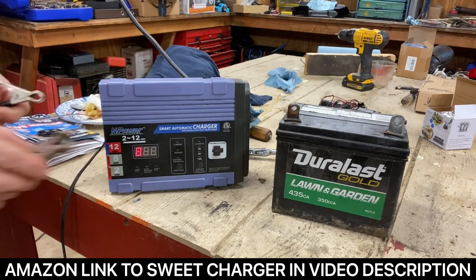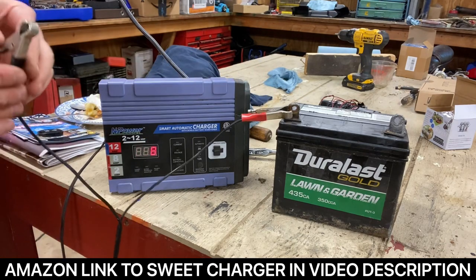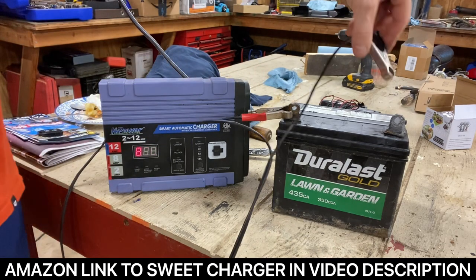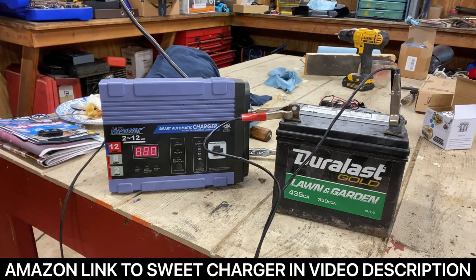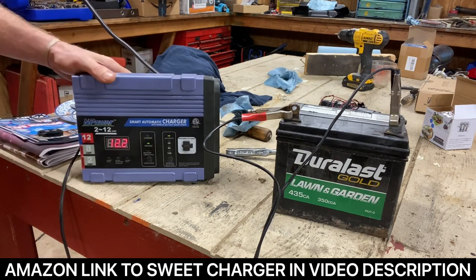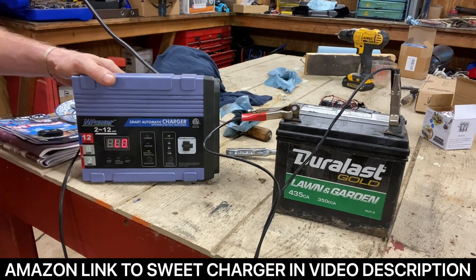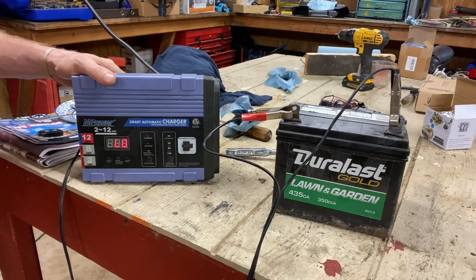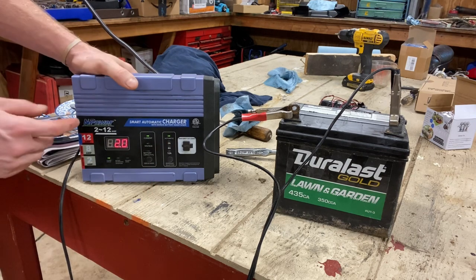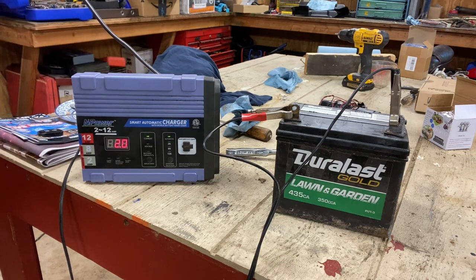I've got a feeling this is going to be a good battery. If you're cool like Mower Mike, you plug in your battery charger to your outlet. Just hook it up like so. What's cool on this thing — you'll see the current it's taking, you'll see the voltage it's got. We got 12.2, and you can even see the battery capacity. Right now it's showing low, and as it comes up it'll show a percentage. I've got it set on automatic. I got this one at Northern Tool — I'll put a link to a similar one on Amazon. Let it charge and we'll come back and see what she looks like.